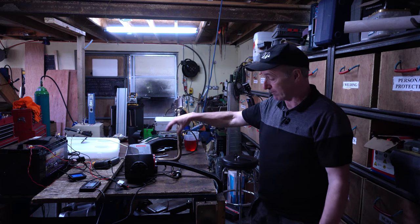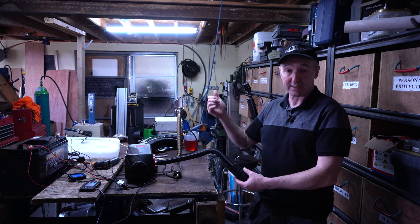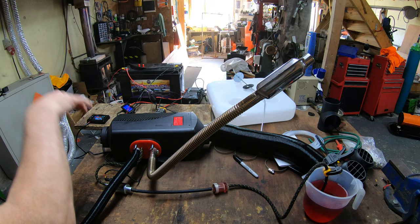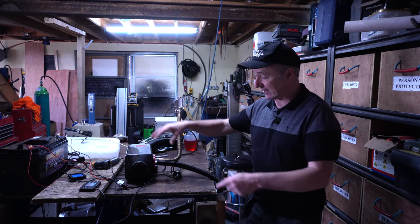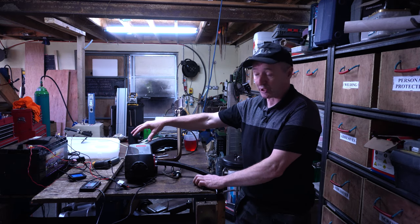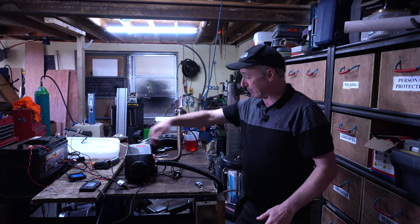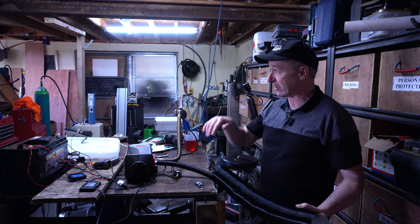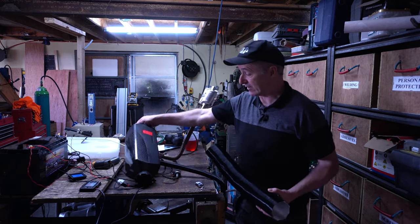Essentially, this exhaust has to go outside no matter what, and this air intake has to go outside as well. So it's getting fresh air from outside, burns it, and sends the exhaust to outside as well. At no point inside the camper van are you getting fumed out — all the fumes are exported outside. Once it's heated the heat exchanger, it takes air from inside your camper and blows it out the other end, so your air comes out of this, blowing five kilowatts worth of heat.